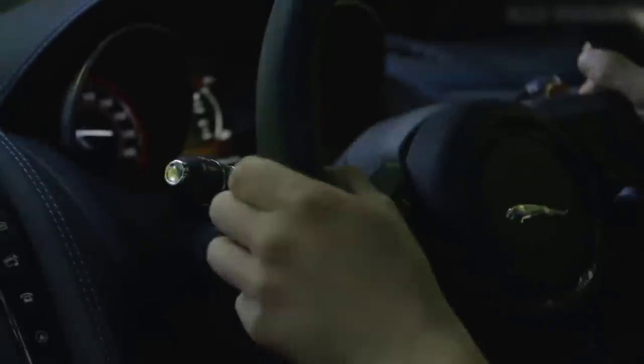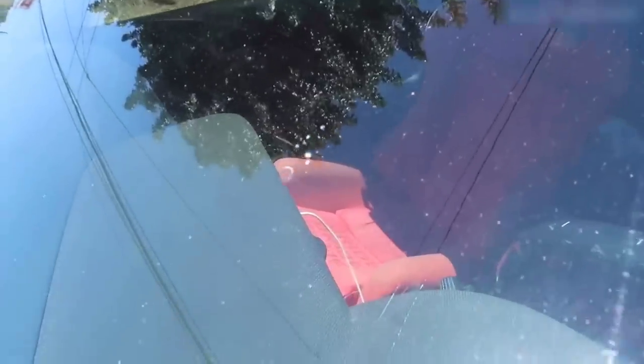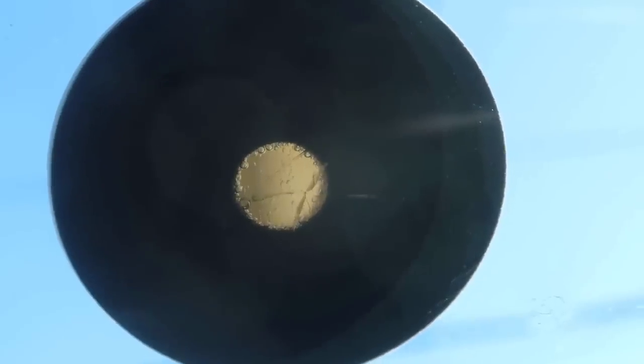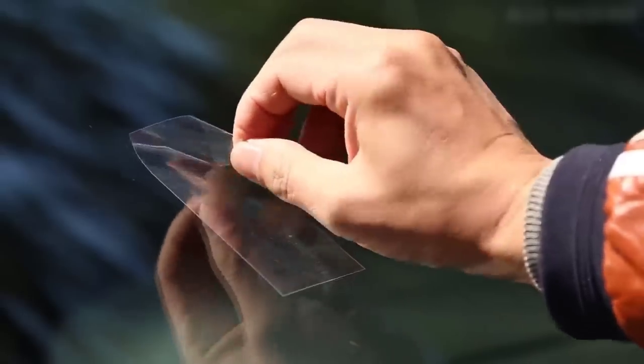It happens that you are driving your car and suddenly you hear the sound of a rock hitting the glass. You stop and look, and there is not just a chip but almost a huge hole. Certainly you don't want to change the glass, but it is also not an option to drive with a chip. For such situations AliExpress sells a windshield repair kit. Clean the damaged place, put a suction cup on the front side of the windshield on the damaged place. Insert the syringe into the suction cup and fill the chip with polymer. After 30 minutes take it all off, remove the residue with a blade, drop the resin on the chip, and cover the chip with tape. Wait till the glue dries — at least 30 minutes in the sun — then tear off the film and remove the remnants. The chipping mark will be visible, but now it is a completely flat surface no different from the rest of the glass, which means the chip won't enlarge and dirt will not get into it.